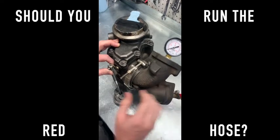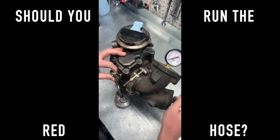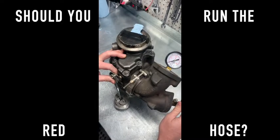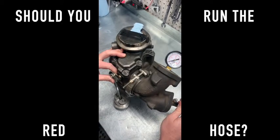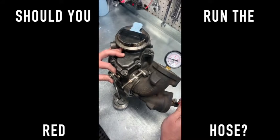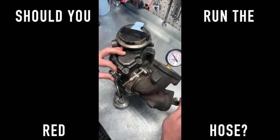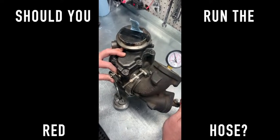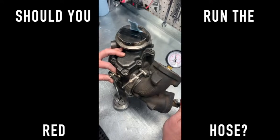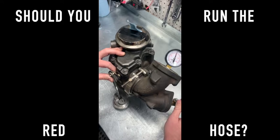Let's tighten it a couple of clicks. After tightening the turnbuckle, let's see how it affects the wastegate. It's still opening, but just a little bit slower. It's fully open by 14 to 15 PSI, where you will notice that it's open.